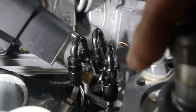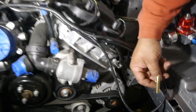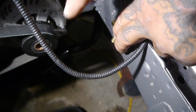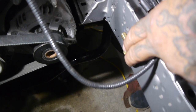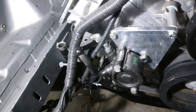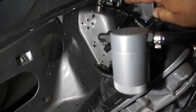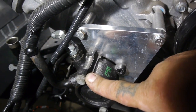This far offline right here is the return line. Follow with me: from this return line we're gonna go down and connect to a T. The bottom of this T will be going to the top fitting of our rack and pinion, this side will be going to the return line of our hydro booster, and this side will be attaching to our cooler line. From our cooler line we'll jump all the way over to where we'll have our power steering reservoir set up.